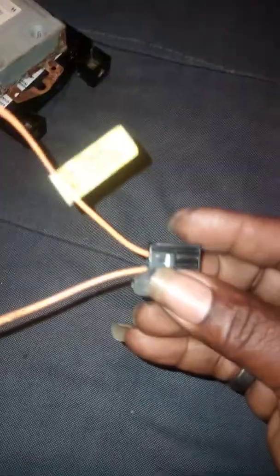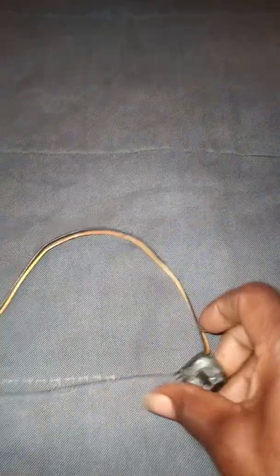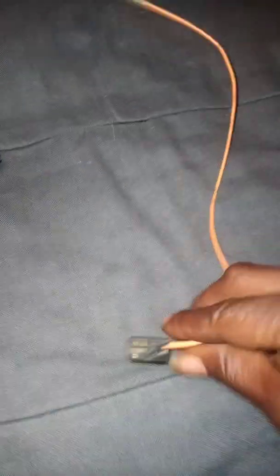When you get done, you should have a cord that looks like this. Unplug everything from those boxes and disconnect — you can take one from either one, whichever you want, except this one, because it's just another cord and not an optical cord. You just want the end part out of that. Like I said, there's a third one you don't even need to mess with. You just want to make a loop like this — this is called an optical bypass.